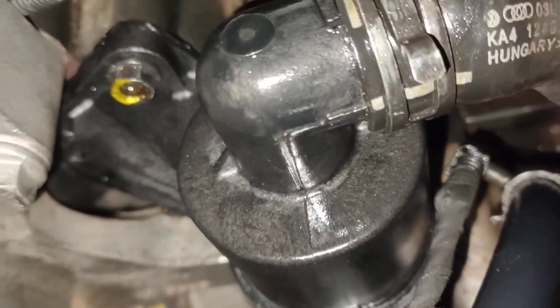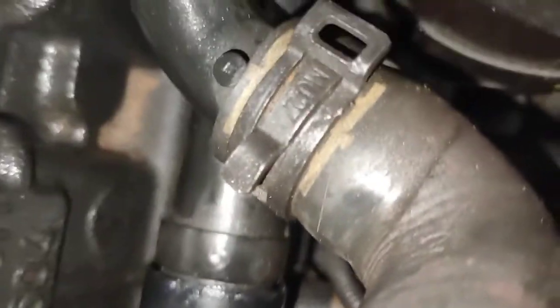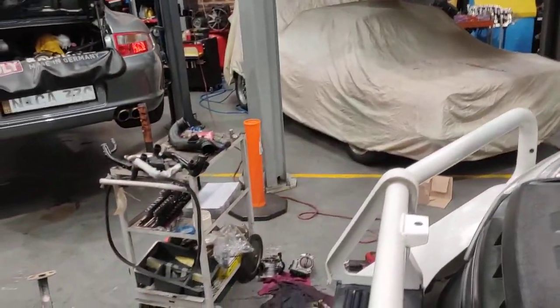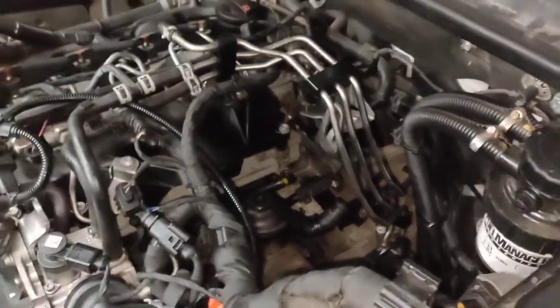Have a look at the actual new part. Here's my new part there. There's my new thermostat. And if you look at the pipe, I've got the new O-ring. Pipes back on. Oil cooler's back on. So now I'm going to start assembling this stuff there on the bench, then put it back together, and put the alternator on and the power steering pump, and then go from there.